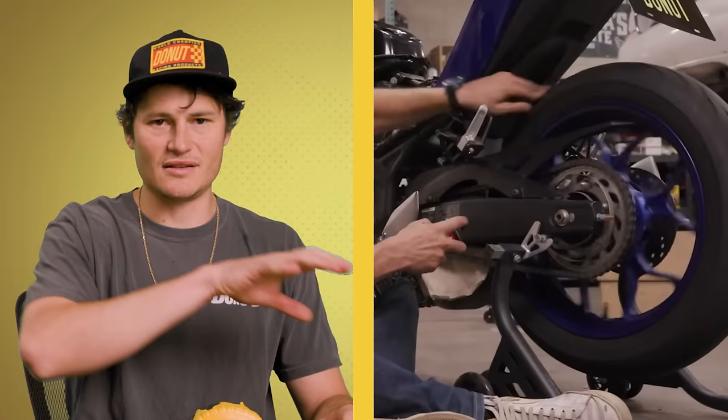The poster of this next clip was working on his bike and discovered he could only move it backwards. With the help of internet mechanics, he found the source of the problem. He dropped a bolt right between the chain and the case, creating a little ratchet — it could go one way but not the other. He was probably thinking there's something wrong with my crankshaft or clutch, but it was just a tiny six millimeter bodywork bolt behind his countershaft sprocket. This is a prime example of why you check the simple stuff first. It's not deadly — total harmless mistake and frankly very entertaining.